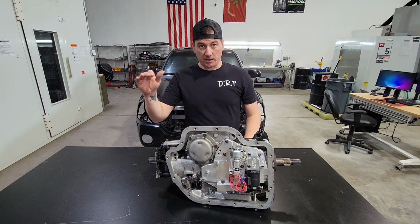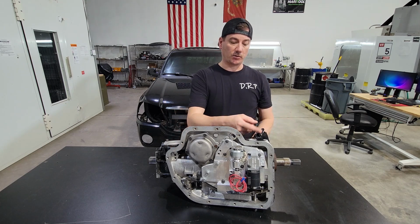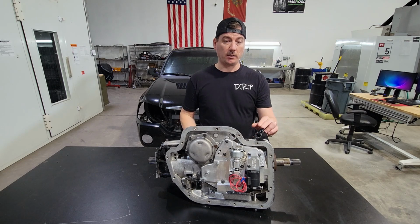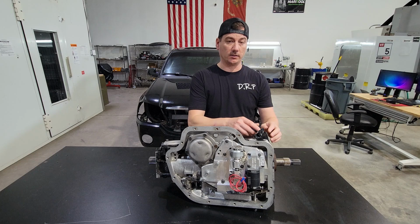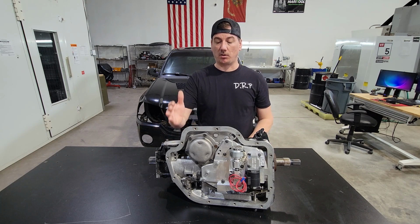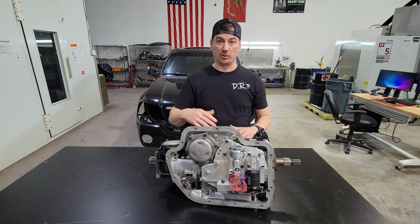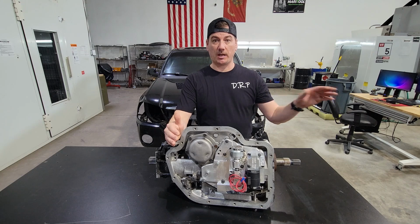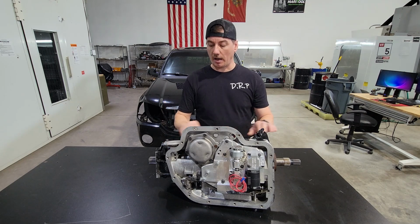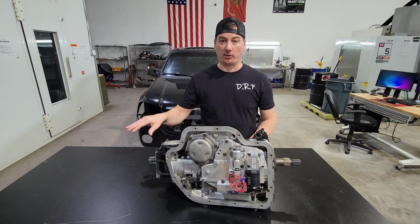However, when you get up to those higher level transmissions, they actually split the circuits. When I say that, they're no longer relying on a return circuit here. They still have the exhaust circuit, but this return circuit doesn't exist on these transmissions. What they're doing is splitting the circuit, independently sending fluid, line pressure, to the return side of this, giving it its own constant circuit to constantly keep this center line of the transmission lubricated. So there is no concern or issue, because they're relying on these heavily to carry them out, keep the engine RPMs up as they launch. You want the RPMs and the turbos always lit, as efficient as possible through the entire run, and that includes as soon as they knock those beams out and they go. So they're relying on these too much, so you cannot have that circuit interrupted. Way too much horsepower on this transmission to have the centerline loop circuit interrupted.